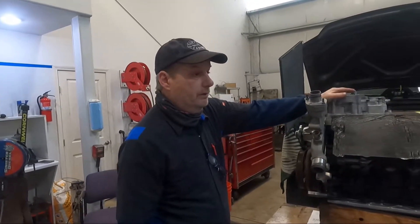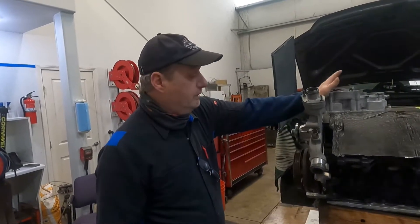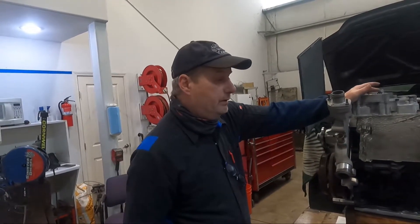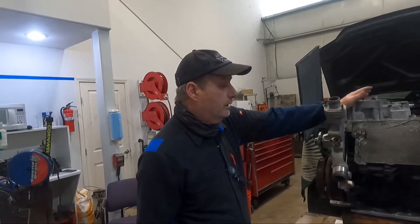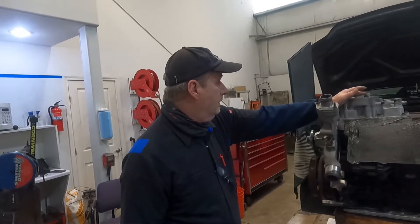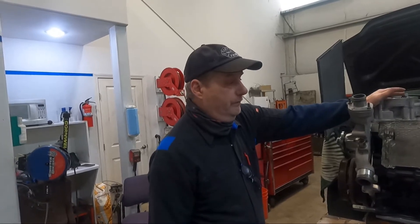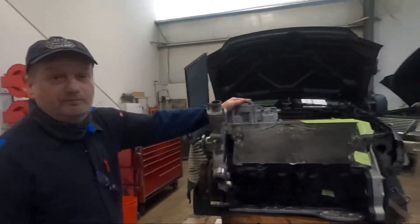When I get the heads back, I'll reassemble the rest of the engine and it'll be ready to go back in. Then we'll pull the transmission out — we're going to overhaul the transmission. It's a 5R110, the best transmission Ford has ever built. It's working perfectly, but we want to go through it, check our end plays, check our clutch clearances, and we'll likely put new clutches in it, new rubbers, replace some of the bonded pistons, and probably a new pump and torque converter — because this customer wants this truck to last him throughout his retirement.